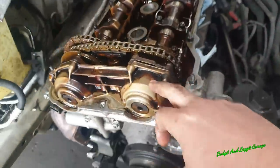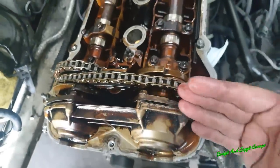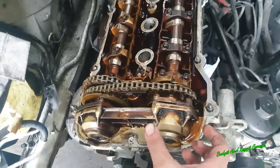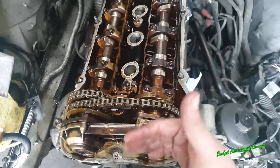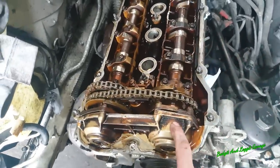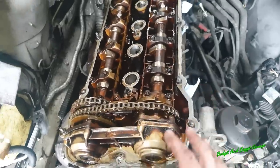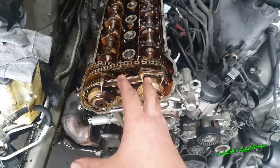The reason is there's two little cams and valves in here, you might not be able to see them. As you're turning the engine with this off, they'll slide out. You might want to turn the engine with this off for whatever reason, or if you haven't got it timed and want to get it timed where this is off, they will start pulling out. So if you get it timed now, you don't really have to do it once this is off. If you're going to want to turn it while this is off, you just put the special timing tool back on here and that stops them. But it's just nice to get it straight first before you actually take that off.